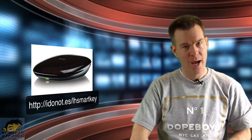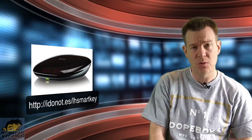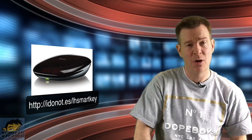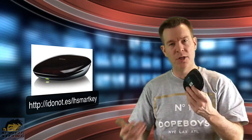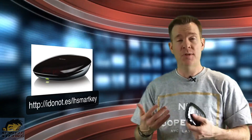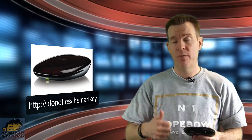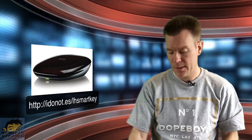There are also tiny numbered USB RF dongles you can plug into devices for RF control, plus Bluetooth connectivity to others. I plugged in the hub, let it do firmware updates via the app, then connected it over WiFi to a Samsung TV and a Roku. Tip: have the model numbers of everything you want to connect. For the Roku you can just say Roku 3 and it finds it on the network, but for TVs you'll want the exact model number. The app then walks you through testing all inputs and configurations.